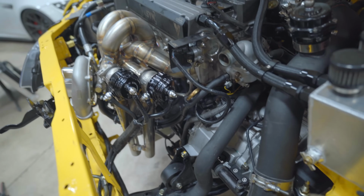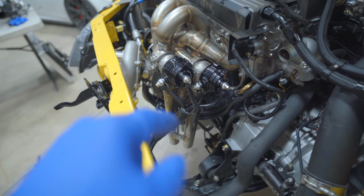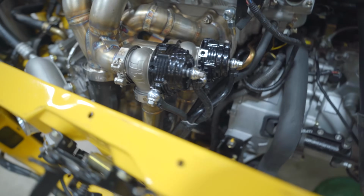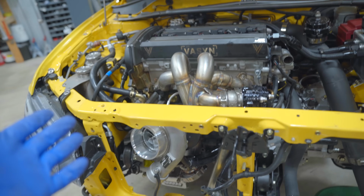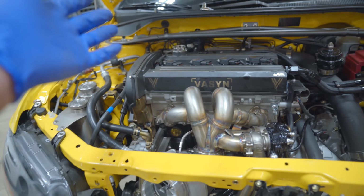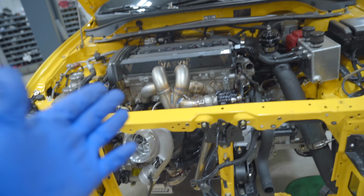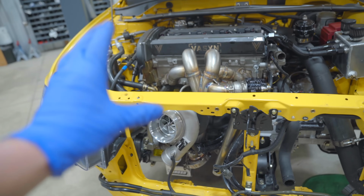Alrighty, we have oil done, cooling done, wastegates are plumbed to the boost controller, ran some nice heat sheathing around everything that is near anything warm. As you can see down there, everything's covered up nicely. What do we need to get this thing to run? To just start, we need the wideband sensor for the Haltech, downpipe to go back on, intercooler pipe, and engine oil. Obviously we can't drive it like that, we still need a cooling system, but I just want to hear this thing run.